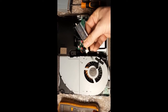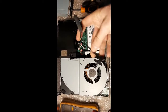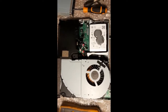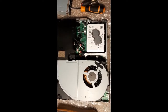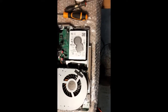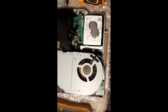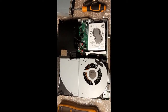Doodah was suggesting that this SATA connection here is just rubbish. In his videos he was describing the exact same problems as me, so I thought I'd have a go. I took a normal SATA connection, cut it up, and joined it onto the two wires.